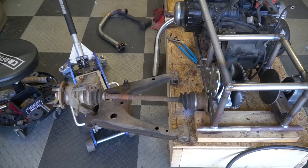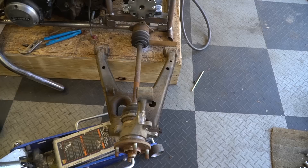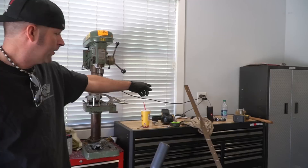At the same time we're mounting the upper and lower control arms, we're going to shorten the Miata axle because the track width is a little extreme. We're also planning on mounting each control arm assembly a little further forward of the center section to shorten up the wheelbase just a little bit, because if this thing has a really long wheelbase and we make it low to the ground it's going to get stuck on everything. The shorter the wheelbase, the lower we'll be able to make the ride height and we won't high-center it on every little root and bump. I'm ready for the first batch of tabs for the lower control arms — I've got the flat bar marked off, ready to cut and bend.